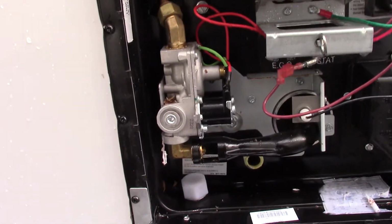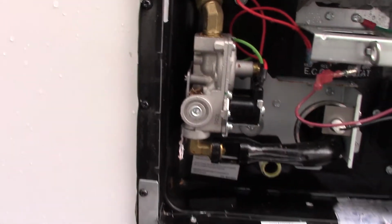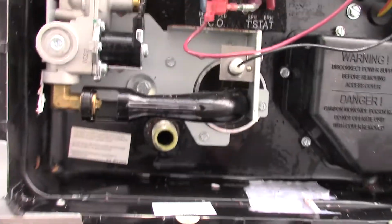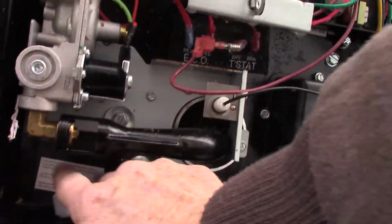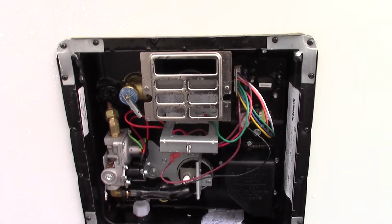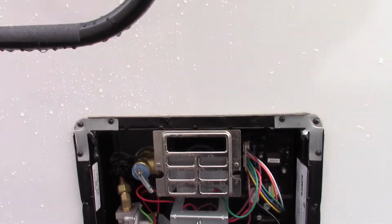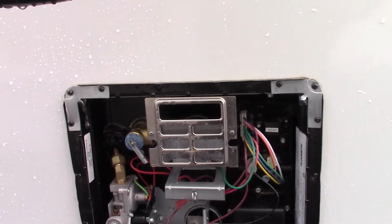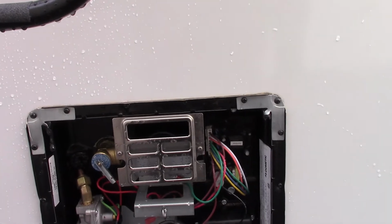is a new style of Dometic heater. The thing to know is it's drained right now because your trailer's winterized. But there's the drain, and this is the cap for it right here. So obviously, before you fill it, you've got to put that cap back on. Now this works on both gas and electric, and the switches are inside the trailer. Never run it without water in it. That's called dry firing, and it'll damage it and it'll have to be repaired. It's not a warranty issue. So always make sure you fill it up before you turn it on.